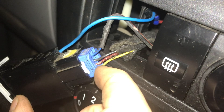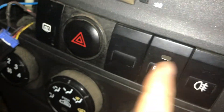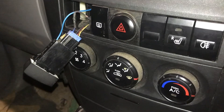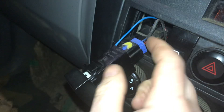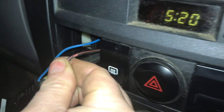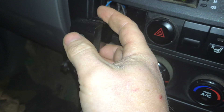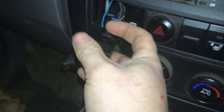The last wire is meant to be your safety — the NTC, negative temperature coefficient. So six holes for six wires. The most important one is obviously ground; that's the red-and-black wire I brought up. Then there's a red one coming up to the blue terminal, which is actually the switching wire — when you turn this on and off it's switching the power. If we turn on the ignition you can actually hear it switching. This blue wire here is the other end of the cable we cut, so that's now turning the relay on and off. When you turn on the side lights, the indicator light here will illuminate.